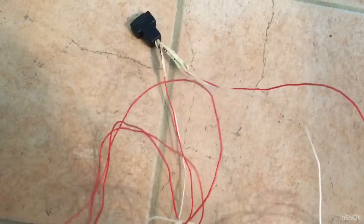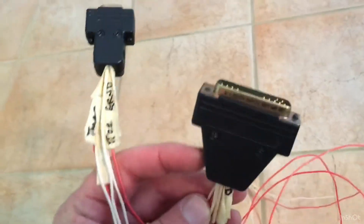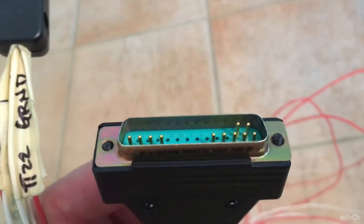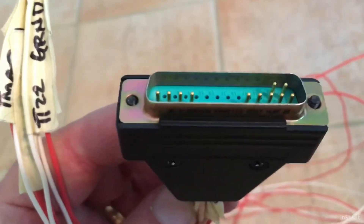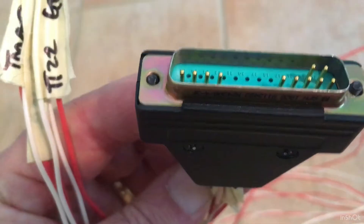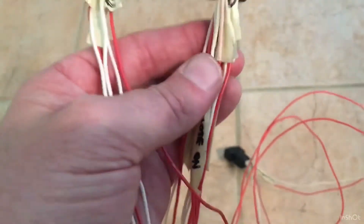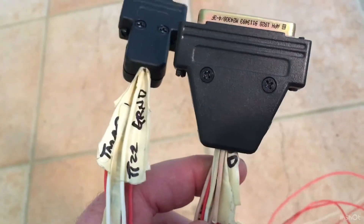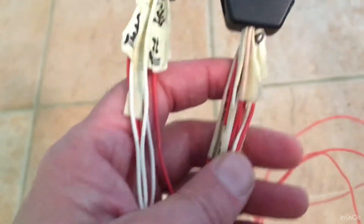This is a funny video probably because of what I did. This is the wiring harness I created for the ADS-B Trig bundle. You can see the pins that I used. This is the transponder — the TT-22 — and I didn't need all the pins because I'm not doing ADS-B in or other things, but this all came with the ADS-B bundle. I labeled everything so that if I got back in here I'd be able to see it. I'm going to tie-wrap these.